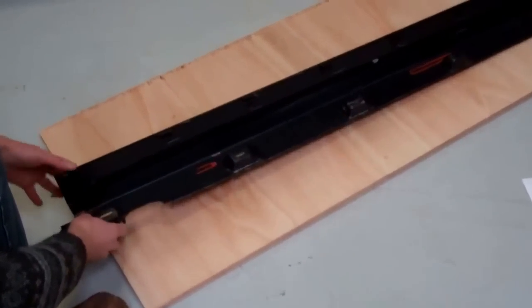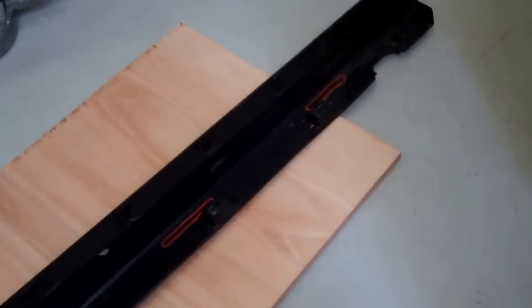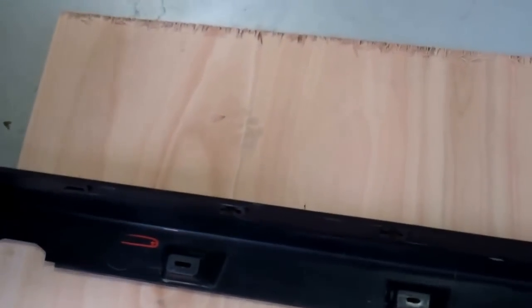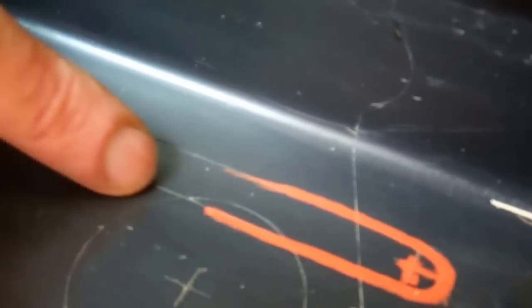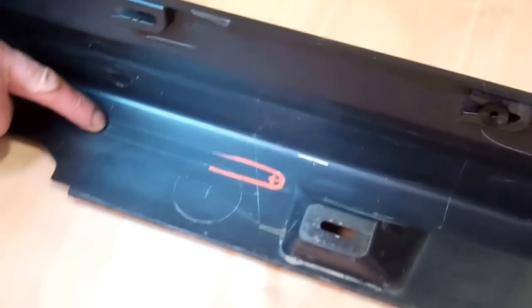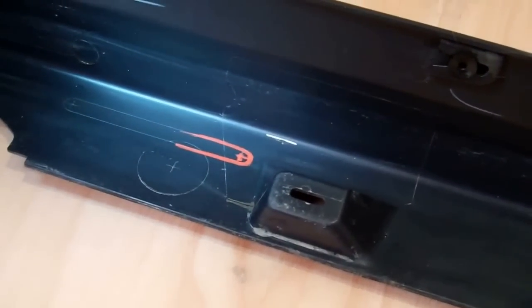We've marked two of the slots in orange so you can get the idea, and half of this slot here. With the torch in, you can see where there's a cross mark — that's where you drill — and this outline is moulded in the plastic on all three slots. Basically we need to drill: the instructions from Land Rover suggest you put your drill on the centre cross and drill out both ends, then cut between them.